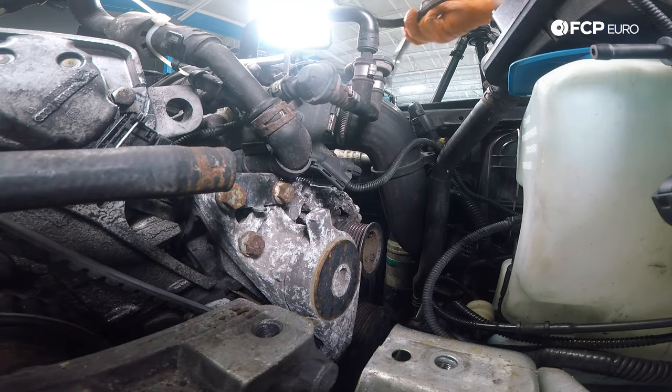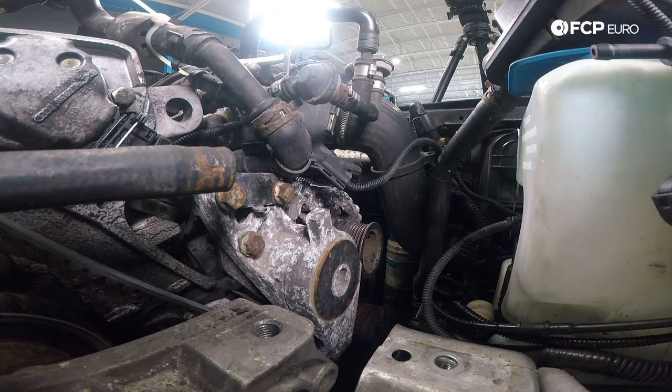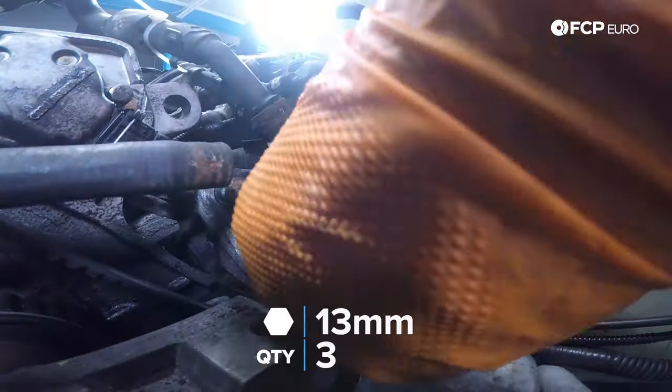I'm going to take it off the next pulley down. To the right of the tensioner is the alternator, and just underneath that is power steering. I'm going to pop it off there, release the tensioner, and take it off. Before you take this off, it's always a good idea to be cognizant of the belt routing. What a lot of people do, including myself, is actually just draw a picture — identify the alternator, the power steering pump, the AC compressor, the crankshaft, and the serpentine belt tensioner, and then just draw yourself a makeshift diagram of how the belt is routed onto those pulleys.